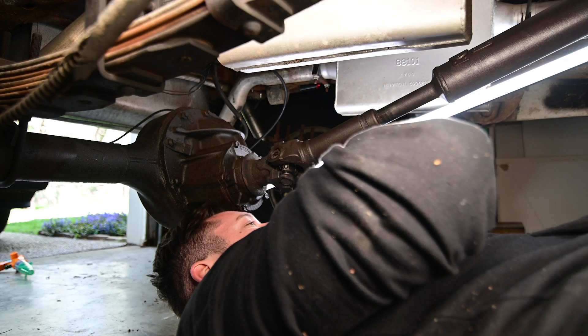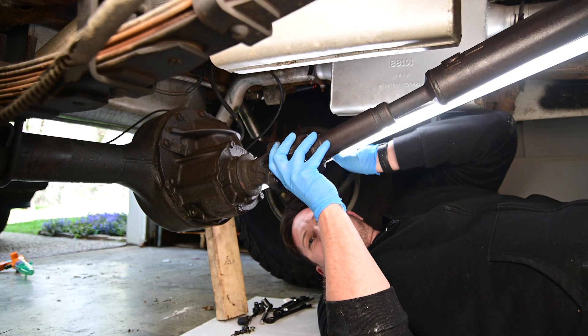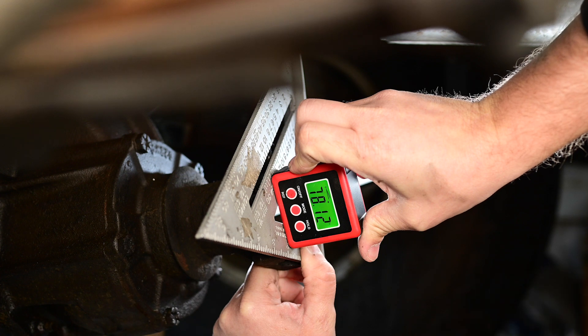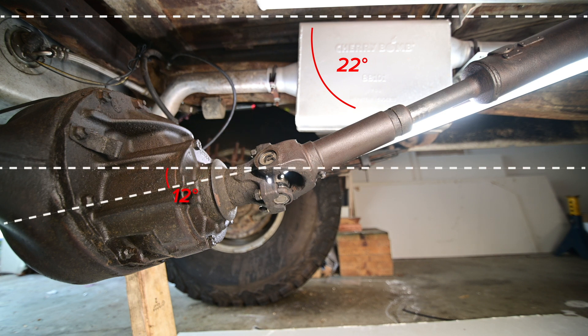Next, we're going to find the differential angle using the face of the yoke. First we're going to remove the drive line to get access to the yoke without anything in the way, then measure this angle by placing the protractor on the face of the yoke. I grabbed something flat to hold against the yoke face. Since we're measuring vertically, this isn't from zero degrees — it's from 90 degrees. Here we get about 78 degrees. Subtracting 78 from 90 gives us 12 degrees, so our differential is at a 12-degree difference. From our drive shaft we have 22 degrees, from our differential we have 12 degrees — a difference of 10 degrees, meaning our pinion angle is right about 10 degrees.